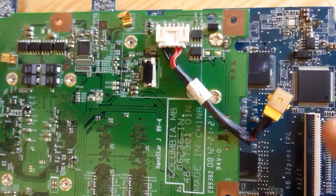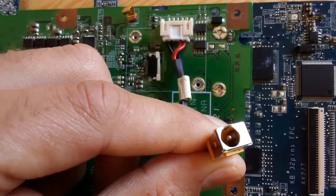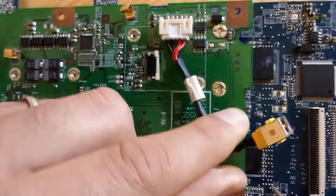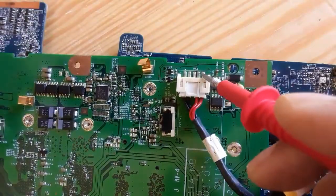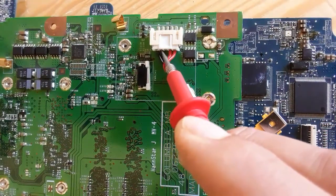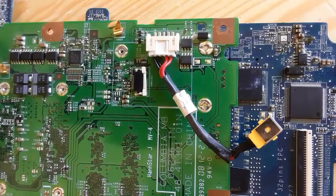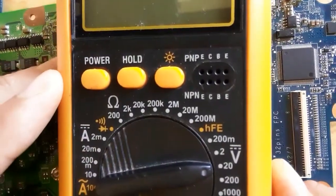In this video we're going to see how to diagnose the laptop motherboard power jack. Here is the power jack — this is the positive terminal in the center and over here we have the negative terminals. The power jack is connected to the motherboard via this cable. The positive terminal connects to the center terminal in the power jack, and the black wires are the negative terminals. The center wire is empty and not used. Always: red wires for positive and black wires for negative.